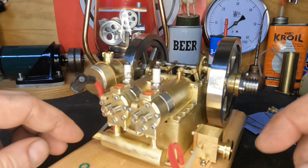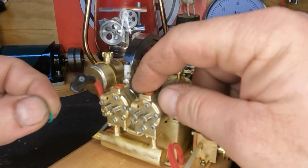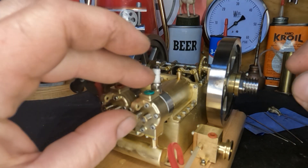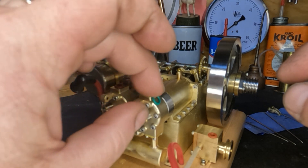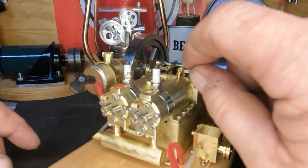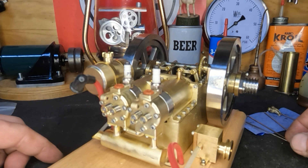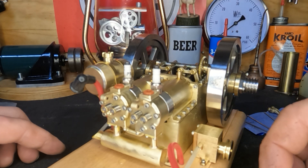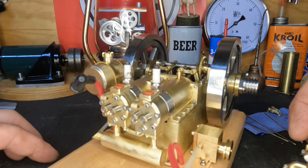The manifold is off and when I pulled it off it was sealed with O-rings. These O-rings have swollen up to the point where they're not going to fit back down in there. I don't know if that was causing a vacuum leak or what, but these are about 70% ready to go and there's no reason we should have to be doing this to a new engine. But I guess we own it, so let's fix his mistakes.